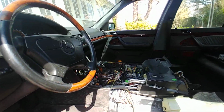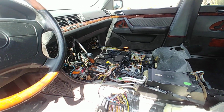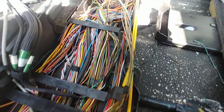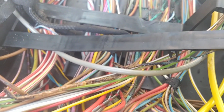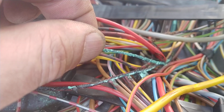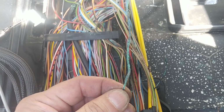I did it. So both mirrors are an older style, and because of the shorts, control module failed, and some wires shorted, not inside the mirrors but also here. Ta-da! That is under the seat. Burnt up wires. Absolute mess. Look at this. Absolute disaster here. And they keep going. This one is broken right there. Here's another piece that was just laying there just because it could.